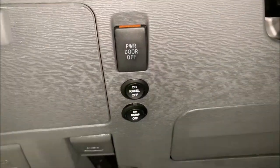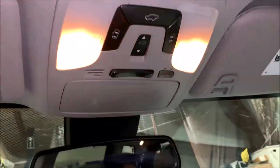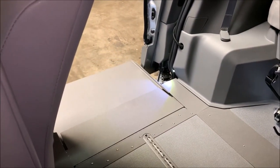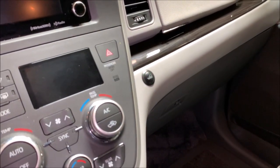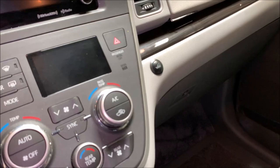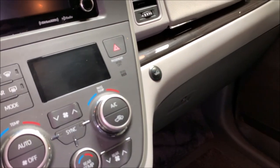If you switch the ramp back on, the ramp system and everything will deploy as normal. There are a couple of buttons on the inside that deploy the ramp system. The one that says VMI will deploy the ramp system. There's also the button on the remote, and there's a button inside the vehicle — pressing it will deploy or bring in the ramp system. As the green light is flashing, it will flash until the ramp system is in, the door is closed, and the kneel is all the way up. If the vehicle is due for service at the end of a cycle, this will flash three times to let you know it's time to bring the vehicle in for service.